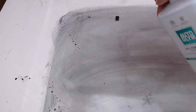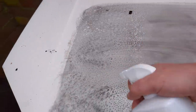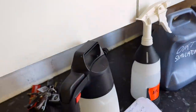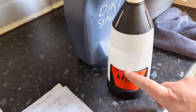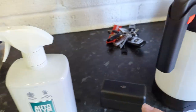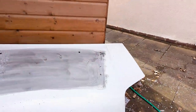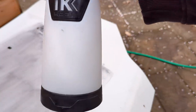Let's take the Auto Glim All-Purpose Cleaner, follow the instructions, and wet out a section of this. Doesn't really matter how much we use as long as it wets it out. Over here I have Surfx HD mixed down at 10 to 1 — so it's a bit like taking a ready-to-use product and mixing it with 9 litres of water: 10% concentration. We'll sit that on there for a couple of minutes, then go on this side with 10% Surfx.